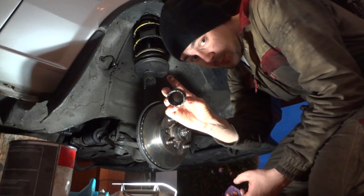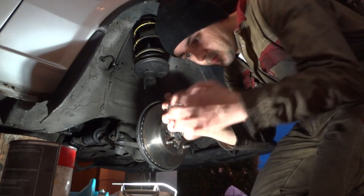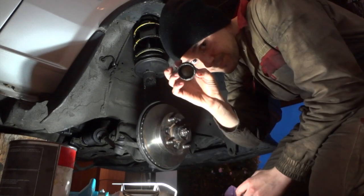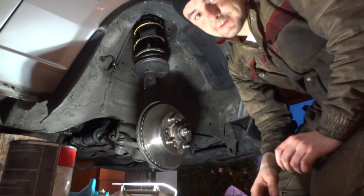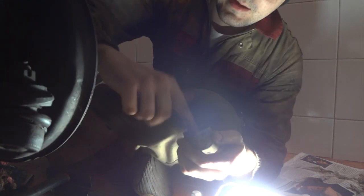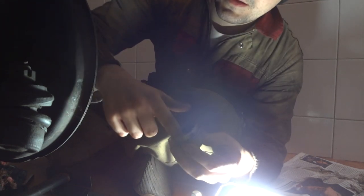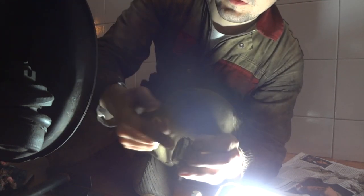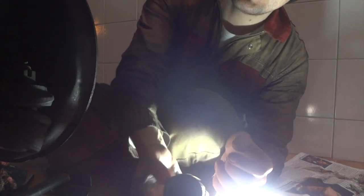Then clean the inside of the grease cap, which is full of old grease, and insert new grease on the inner part of the grease cap. Yeah, it's easy. Now put some axle grease on the inside of the grease cap. Not just a coat. You have to leave a layer of grease in there because this acts as a small reserve of lubrication to go around the hub and ensure that those bearings always have nice and clean axle grease to lubricate them.